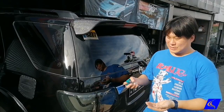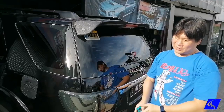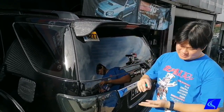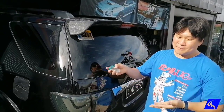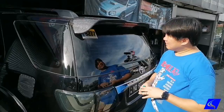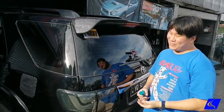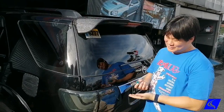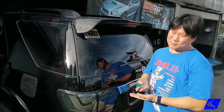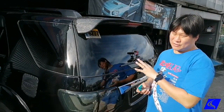It's like the grains of a tree trunk. You can split the wood easily along the grain, but it's hard across the grain. So that's what the forging process does. You arrange it randomly, so there is no grain per se. So it's very strong in both tension and compression. It's not forging like the way they do forge aluminum wheels where they press it with heat. No, it's not like that. It's simply forging by pressing it into a mold, and you release all the resin and you're left with pretty much pure carbon fiber with just the minimum amount of resin involved to bind everything together.